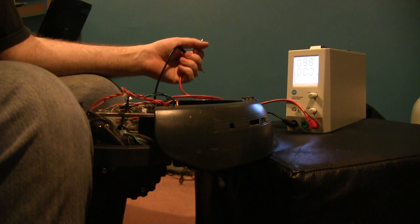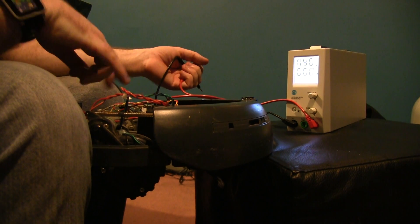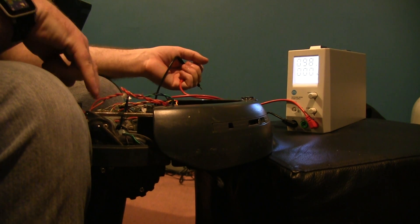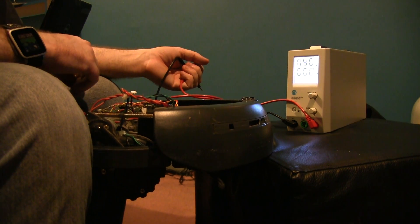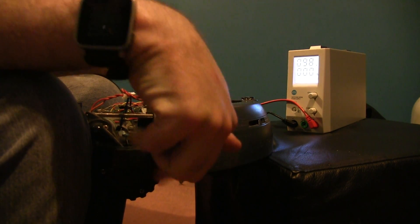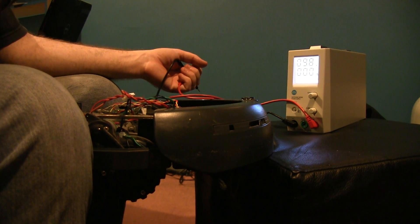Actually, about 0.45. So we've got 0.45 — call it 0.5, half — so that's an amp between each wheel, about another half for the brusher motor, and another 0.15 for the blower and the side brush. So just for motors, I'm talking about 1 and 3 quarter amps.